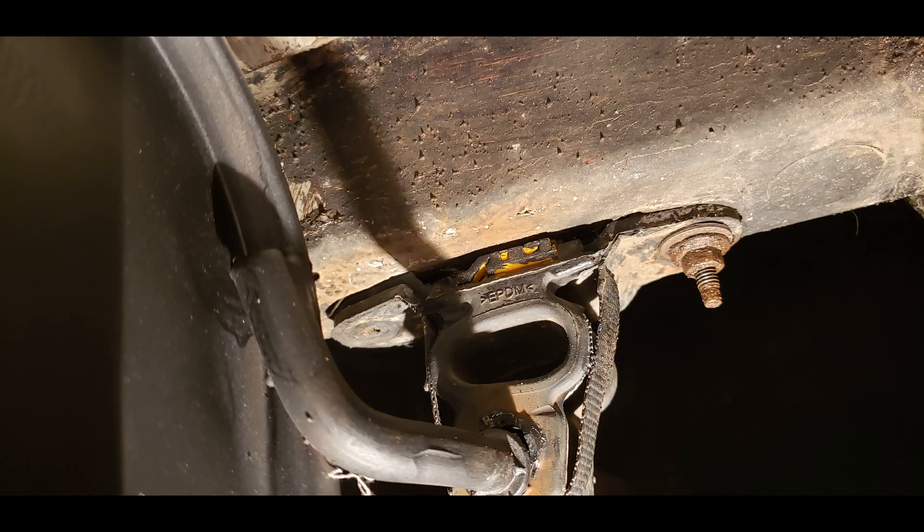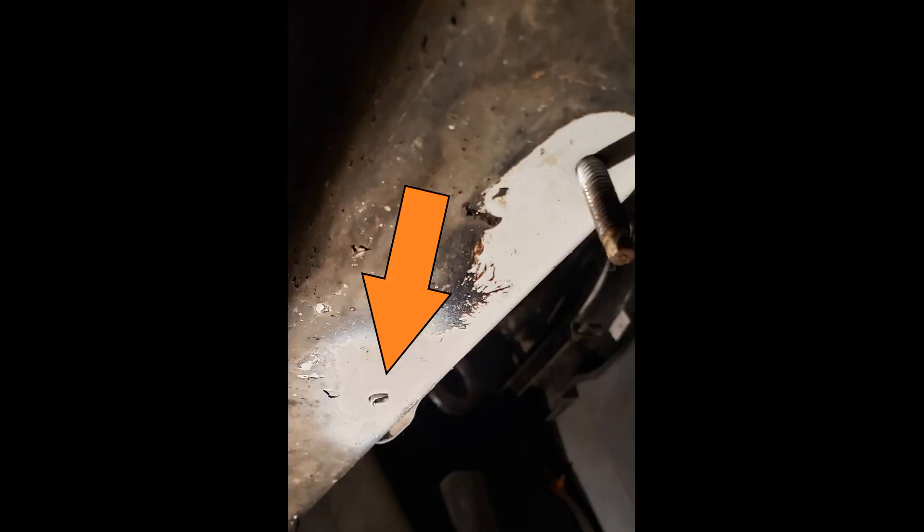That's why I had to buy a 1.2 version made in Poland. The first thing I did was covering it with black protective paint for barbecues, hoping it would prolong its life. I had to cut the exhaust pipe and then remove the silencer from the exhaust damper. The only problem was that the fastening was stuck inside the damper and I had to unscrew the damper's bolts, which were too rusty — and one was broken.